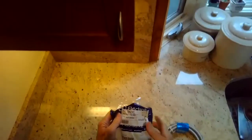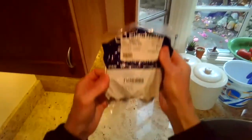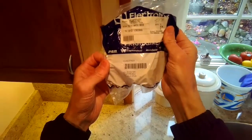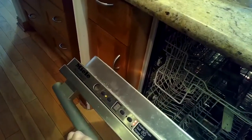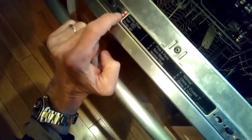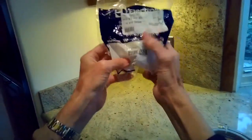This is Scott the fix-it guy. Today we're dealing with a Miele dishwasher that is overfilling — the water valve is stuck open. The intake drain light is blinking and every time we start it we can hear it constantly draining, which tells us the drip pan underneath is full of water. This is due to the intake valve not closing all the way, staying a little bit open, so even when the dishwasher is turned off, water is building up inside and leaking into the drip pan.